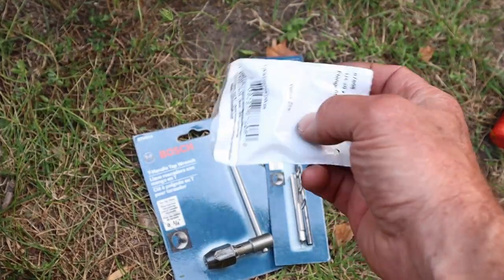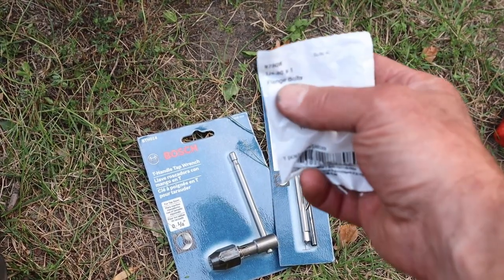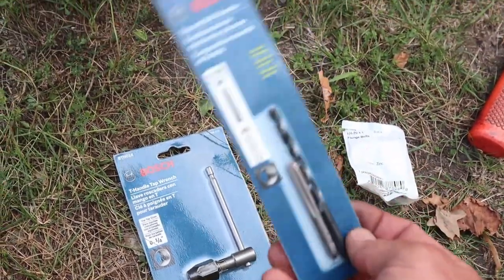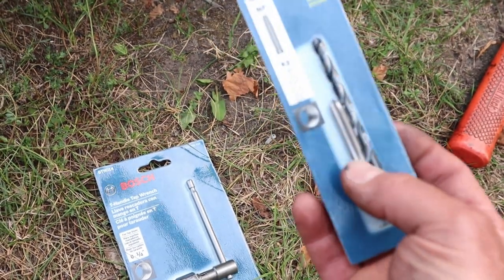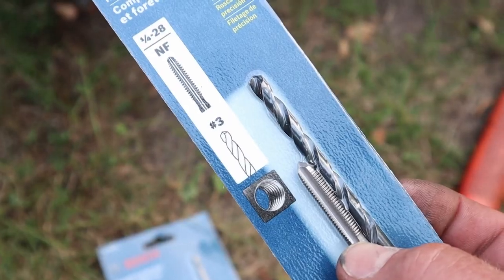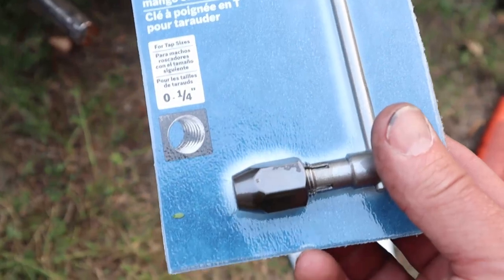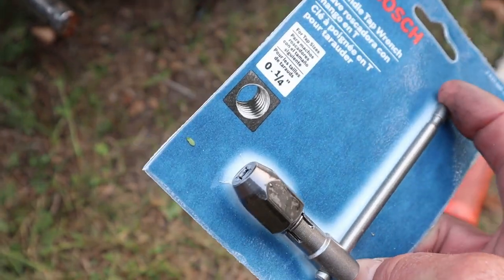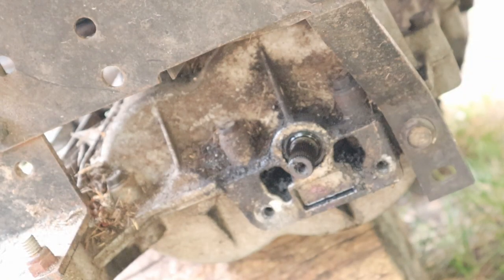The other one I was able to check, and it's a 1/4 inch coarse, or 20 threads per inch, I guess. So you drill a hole, and then you run this thing in there, which will cut, let's see that picture, sort of, will cut threads that your bolt will work on. Now, it's good, I didn't have any taps, they're all at home. So this thing is what you need to put on the end so that you can sort of screw it in straight. I'll show you how it works.